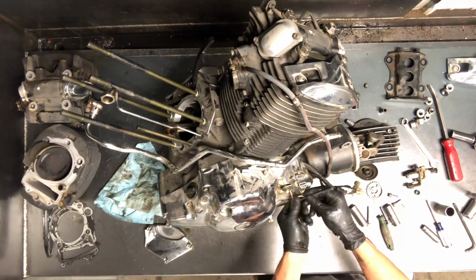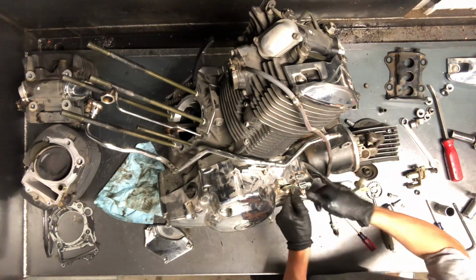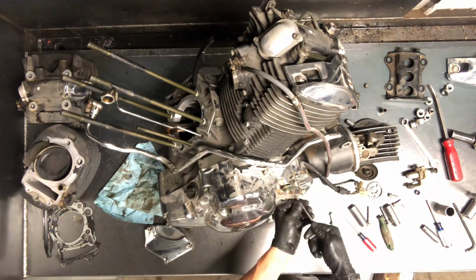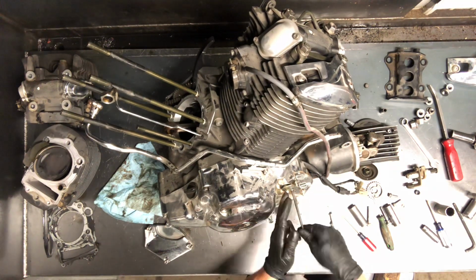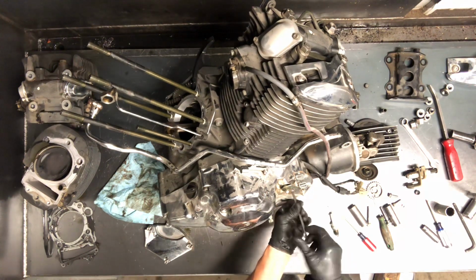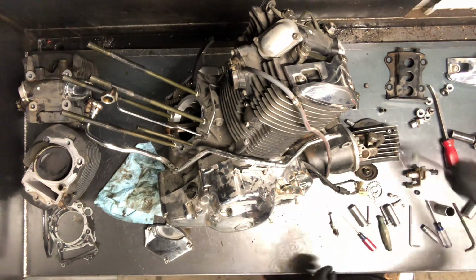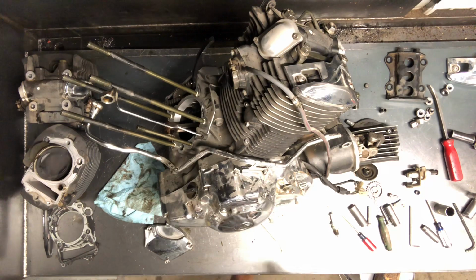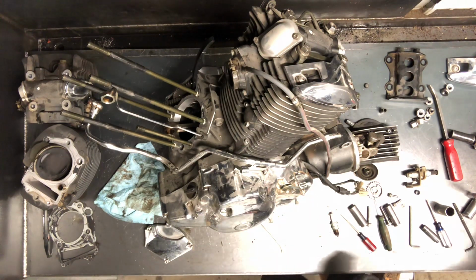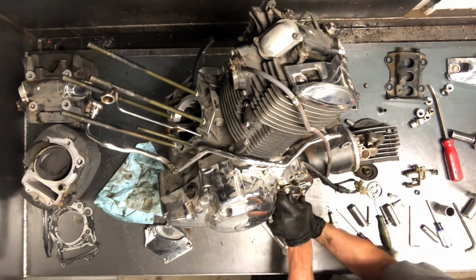We've got to pull this clutch arm off to pull this cover, I believe. We might have a cover, that arm may stay with this cover. We'll have to see, but you can adjust your clutch there. You've got a 12mm nut on there. And what you do, I'll show you how to do that quick. You just go ahead and loosen that lock nut here.